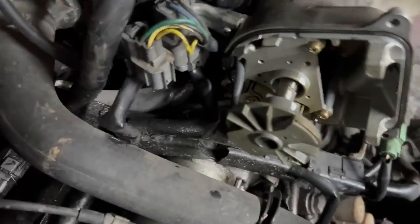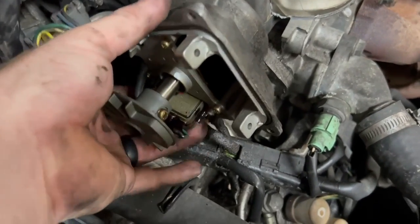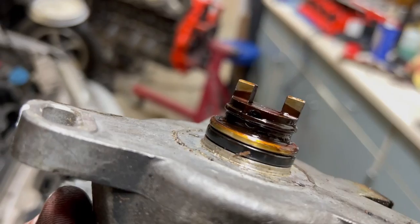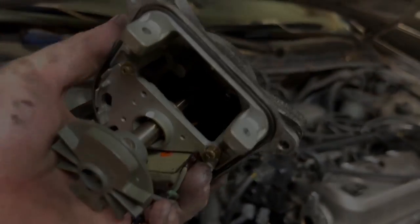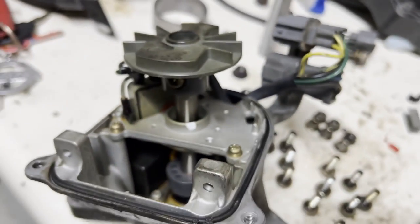What did I miss? There's a third bolt hiding down there. All right, that did it — came right off. Now that it's not attached to the camshaft, the rotor's spinning freely, so to get that right we'll have to line all those holes up when we stick it back in. That little O-ring right there looks more like a washer — it is dirty in there and it's a problem. Pop that new O-ring on there, slide it back in, and the distributor oil leak should be fixed. Wait, I'm not done. There's more than one seal in the kit, because there's one further down inside. In order to get that out, I've got to take all this apart real quick.